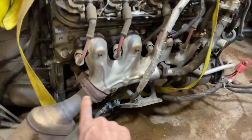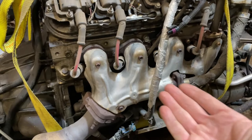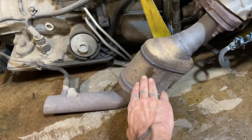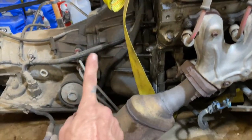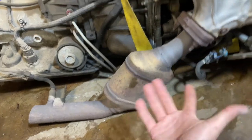The wiring that goes to the secondary O2 sensors after the cats — because we're going to be cutting the cats off and telling the computer, which I've already done with the HP tuners, that we're only going to be using the front O2, which is somewhere down there. So there will be an O2 here and on the other side there will be an O2 there as well. So we still get engine management through the computer — it can tell that this bank is running rich or lean and adjust accordingly. Those O2s are just to tell the computer that it is still complying with the EPA and has a working catalytic converter, so that when your cat starts getting clogged that O2 starts telling the computer to trip the dash light, so then you know you need to replace your cat to continue to catalyze unburnt gas and fuel emissions efficiently. We're not doing that.